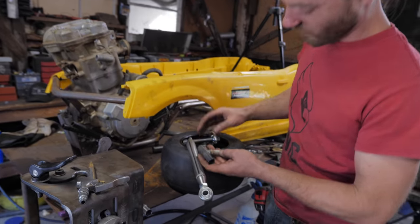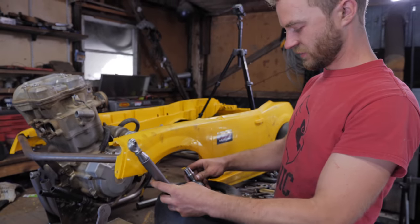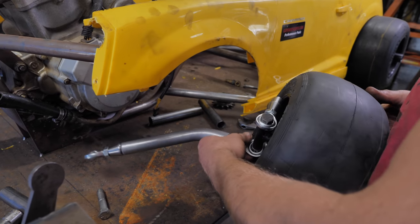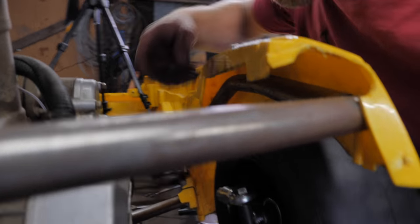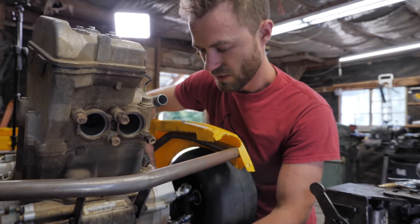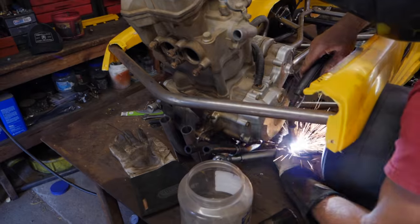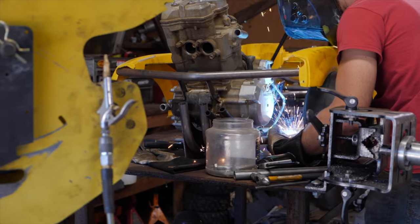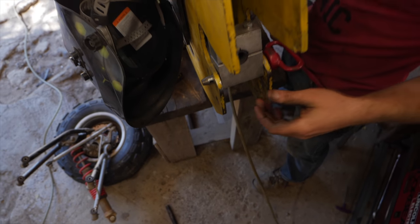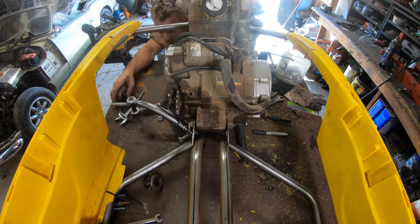Got my spindles all welded up here. They don't have the steering arm on them yet, but I'll add that later once I figure out where everything else goes. That's how it fits in the wheel. I'm starting to work on the control arm — it's not that complicated, it's just a lot of different things to think about and where to put things. That pivot will probably be somewhere around there. It's not going to be a double A-arm, just a single A-arm for simplicity and space.